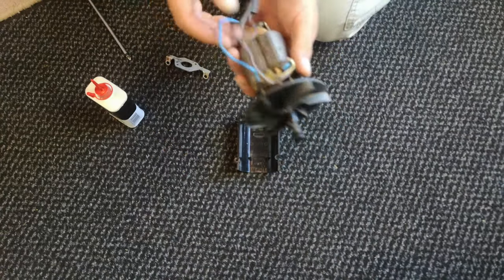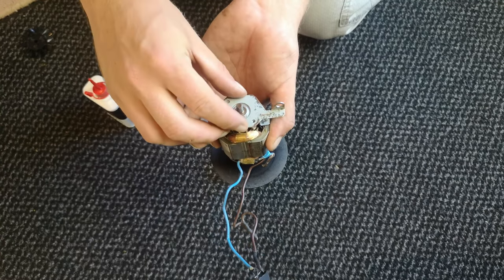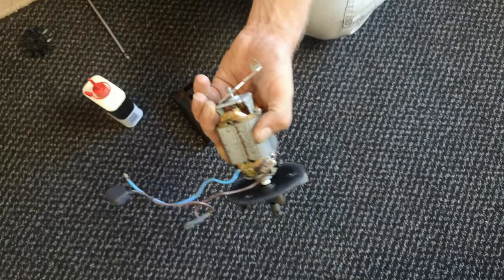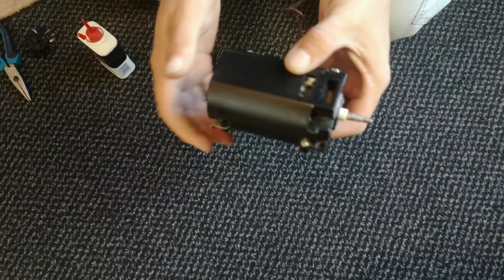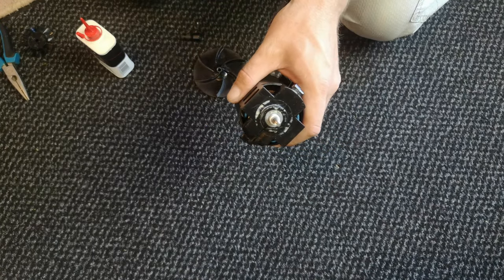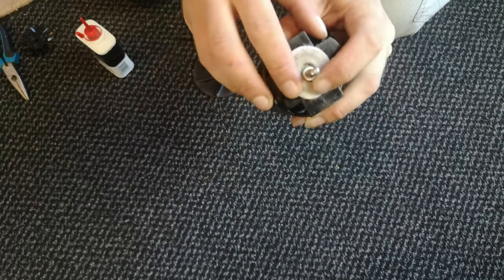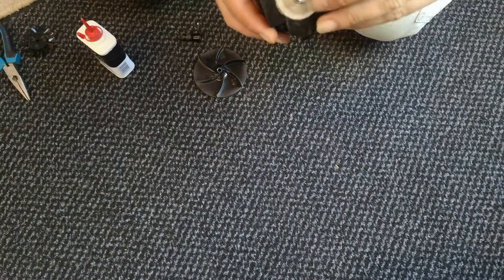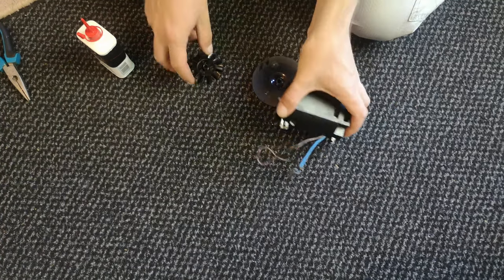I put this housing on the wrong way around - that was very stupid. I think it goes on that way around, then I need to line up the casing and remember where the wires came from. With two steps back, one step forward, I have the motor in its casing but with the fan off - because I always forget the felt seal. I'm going to put that on with a little drop of superglue to stay on there, get the fan back on, get the rear fan on, and then we should be ready to start chucking it back into the machine itself.